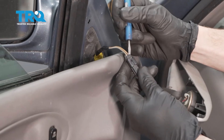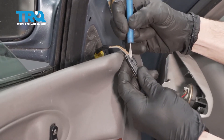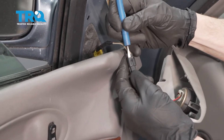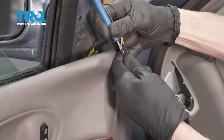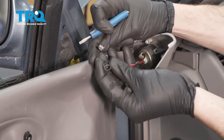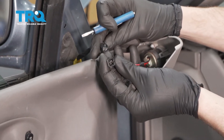Now we're gonna start separating this wiring harness. I'm gonna use a small pocket screwdriver and the area that you wanna try to get in between is the two parts of the wiring. I'm just gonna get right underneath this lip, gently pry it apart, and then we'll separate the two. Once you have it apart, give it a quick inspection. If you see any funny colors, it's corrosion and it would need to be dealt with. This one looks fine, so I'll set it aside.